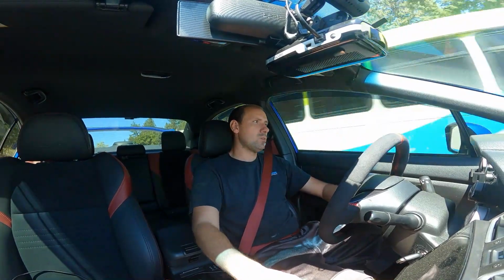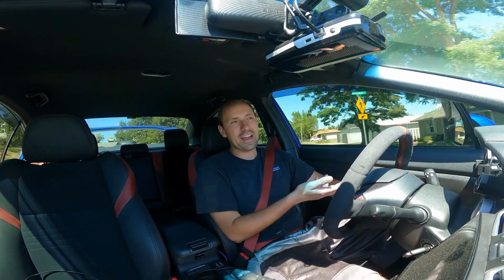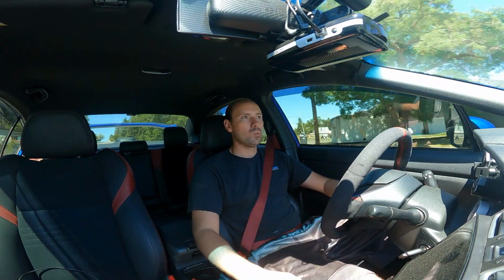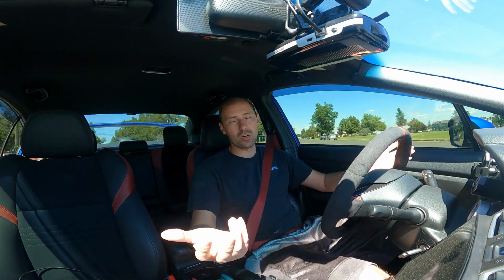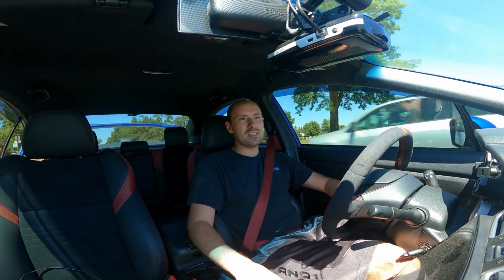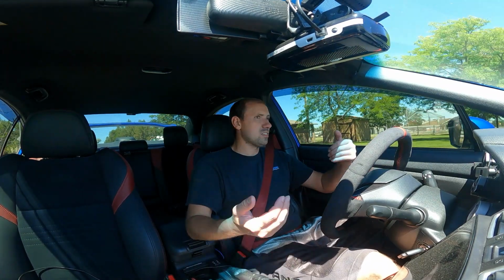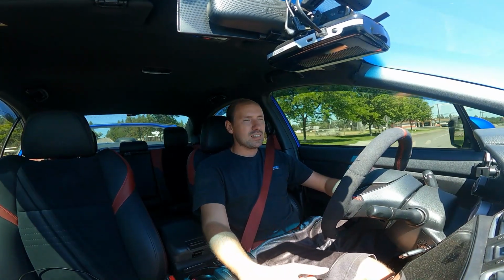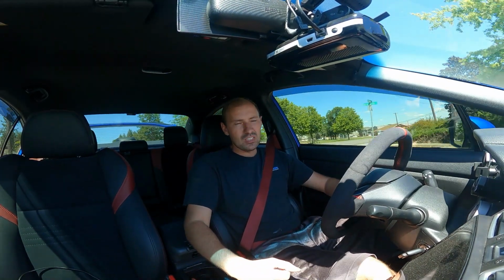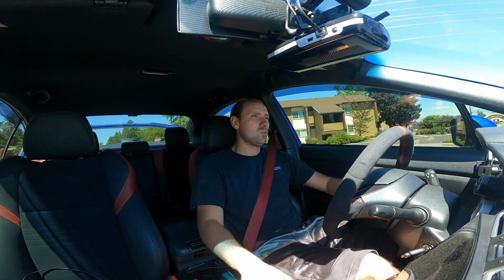So that might be helpful, and you know, to talk back and forth with you guys about that too. When it is like 90 plus degrees outside, no, you should not be out there ripping on your car. You have to keep in mind the heart of any engine is oil, and once your oil temps get hot enough, the oil loses viscosity and the protection that oil is there for. So that's a big thing, guys. When it's this hot out, just enjoy that you have AC, which I'm sure most of you do, especially in newer cars, and just enjoy your car and cruise around.